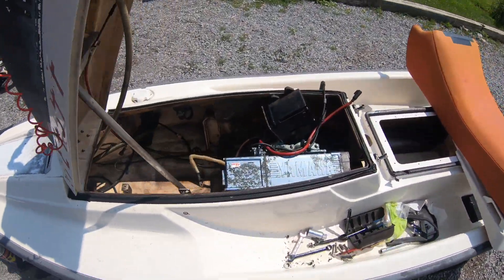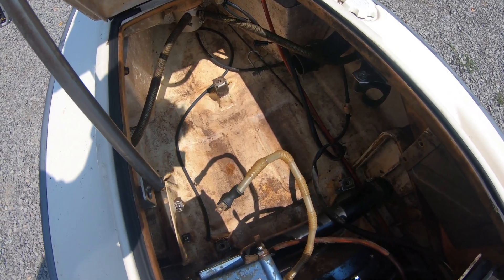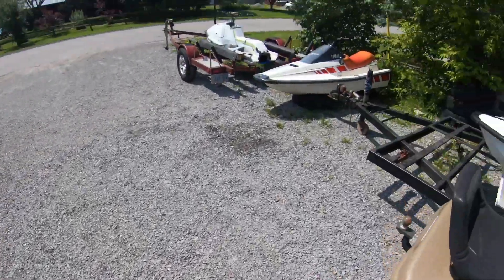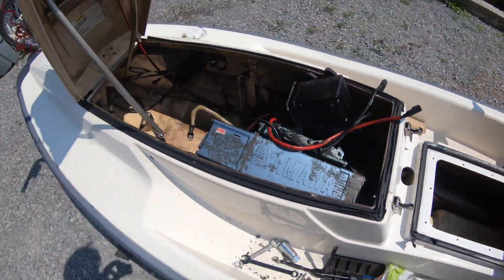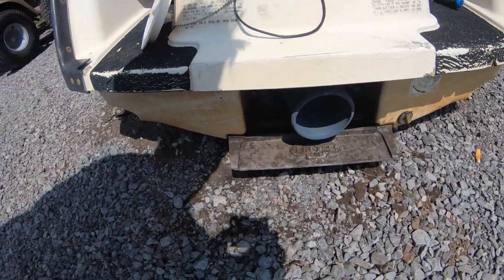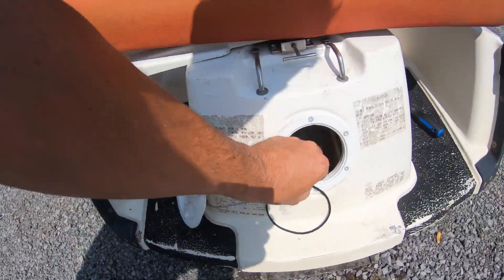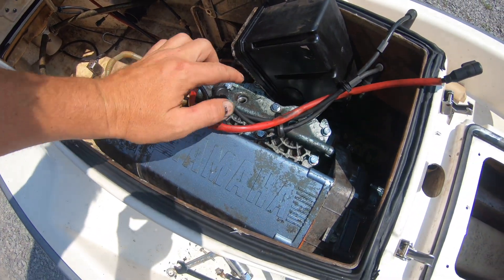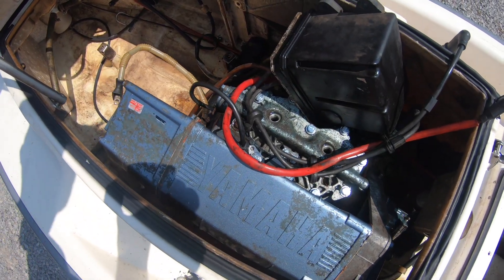After a quick wash — I should have removed the fuel tank first, but I didn't, so I'll have to rewash the inside. The hull seems to be in good shape. It's got an aftermarket ride plate on it, a Protech DBP, which is kind of funny — I've never seen one on these. I found the seal floating around in there, so that's good. I did a compression test: 138 and 139, so I'll just round it to 140.